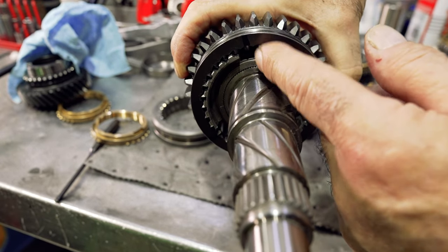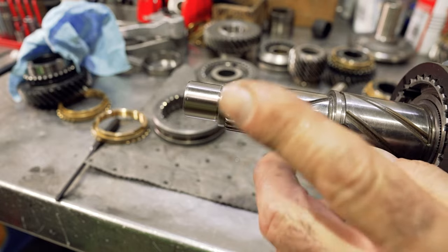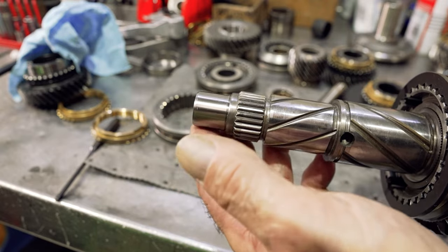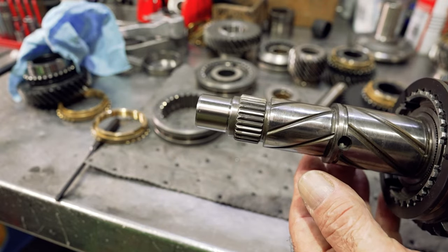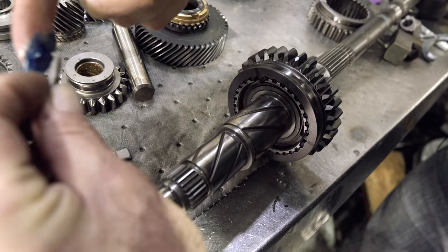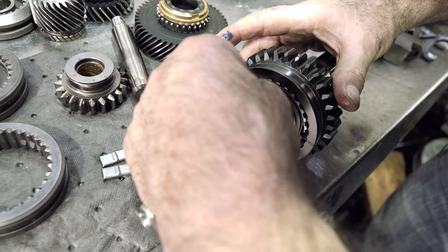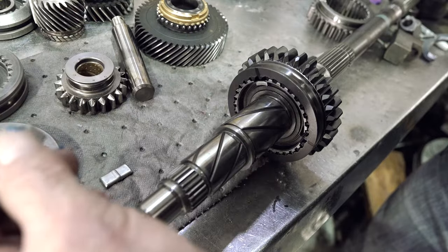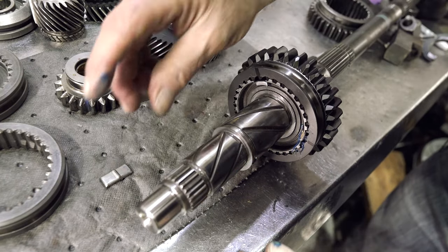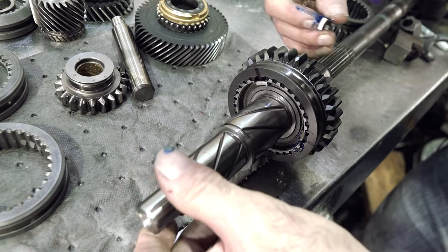My mark is right in the middle of that groove so I know where it's got to go. This main shaft, by the way, was repaired — a sleeve was pressed in over it and then reground to the correct dimensions. I'll take some grease and put it on the bottom and top of the key for the 1-2, and just put the key in place without the spring. We've got three keys going in here. You can use grease or assembly lube — it doesn't really matter. I don't like any of that white grease; just any mineral-based grease is probably fine.